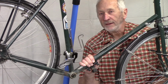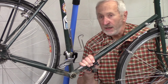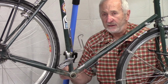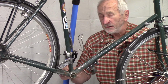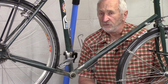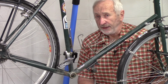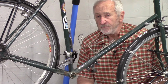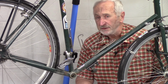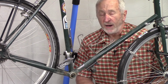I successfully removed the cranks, and I'm thankful for a lot of good YouTube videos that showed me how to do that, because I've never really done this before. What I've confirmed is that my bottom bracket does need to be replaced. When I rotate the axle of the bottom bracket by hand, I can feel some resistance, and I can also hear kind of a metal-on-metal rubbing sound coming from the bottom bracket. I compared that with the new bottom bracket, and the new bottom bracket doesn't do that. This also says to me that the right way to test the bottom bracket is to remove the cranks. When you simply rotate the cranks on the bike, you get a misleading sense that the bottom bracket is fine, because the mass of those cranks makes it very easy to spin, even though there's some resistance in the bottom bracket. So I'm ready to replace my bottom bracket.